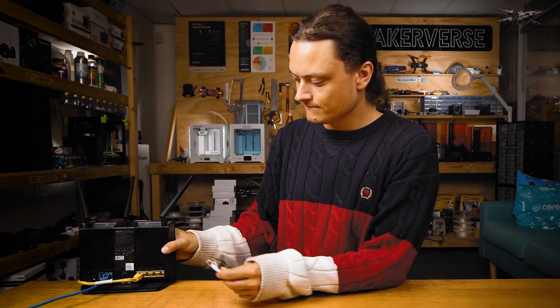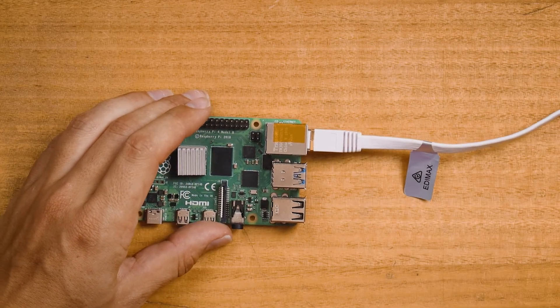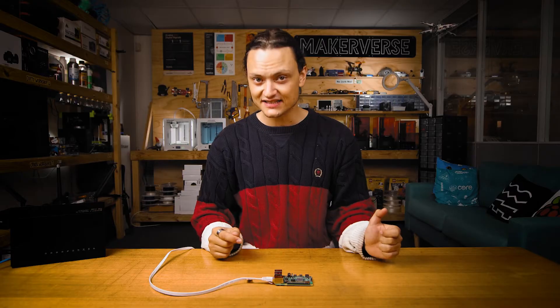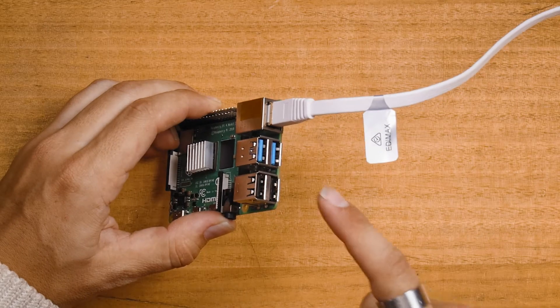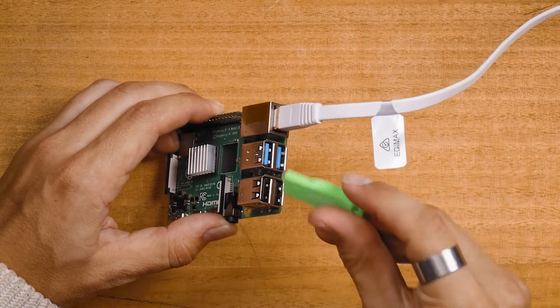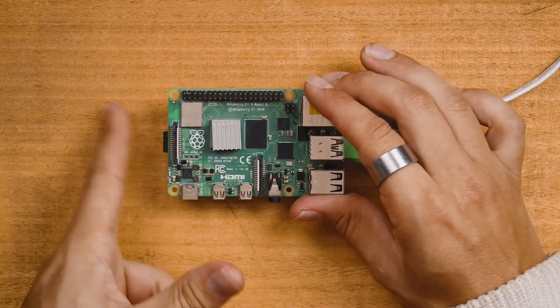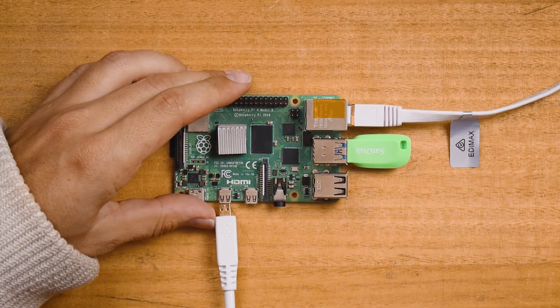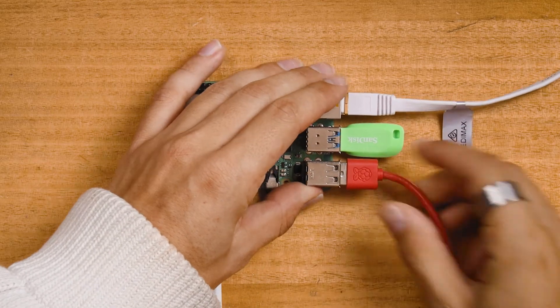With both of these parts sorted, let's connect everything else. Connect the ethernet cable to the Raspberry Pi and to your router, switch, or modem. This NAS setup can also be done using Wi-Fi if desired — check the full write-up linked in the description. Connect the USB stick to one of the USB 3.0 ports on the Raspberry Pi. The USB 3.0 port is easily identified by the blue internals of the USB connection — it is also the central USB connectors on the board and operates at higher speeds. Next, slide in your flashed micro SD card, and connect a micro HDMI to a monitor, plus a USB keyboard and mouse.